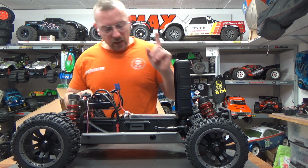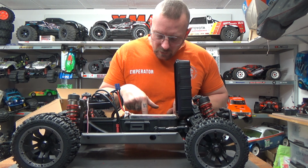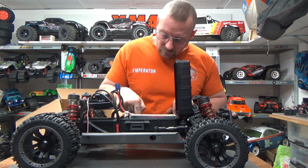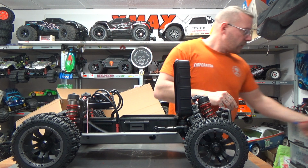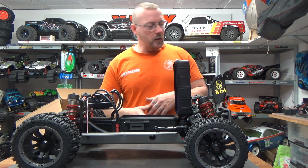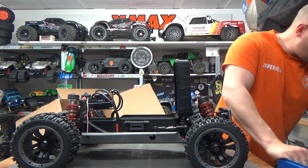Also in height, you can get to 196 millimeters long, 53 wide, and 85 high. So that means you can also put two 6S batteries in here without any problem. For those who want to run 6S in parallel, to have 6S with double runtime, you can put an 8S battery up to 10 or 12,000 milliamps maybe in the truck.